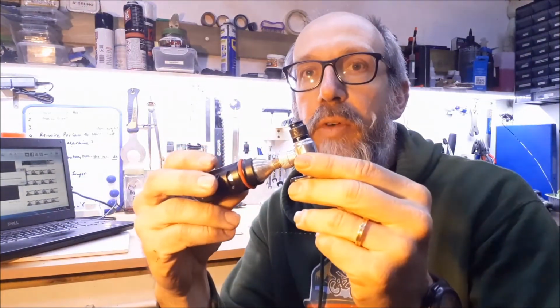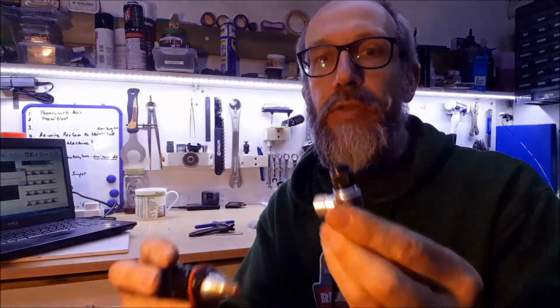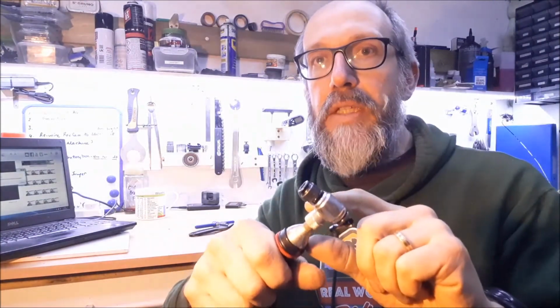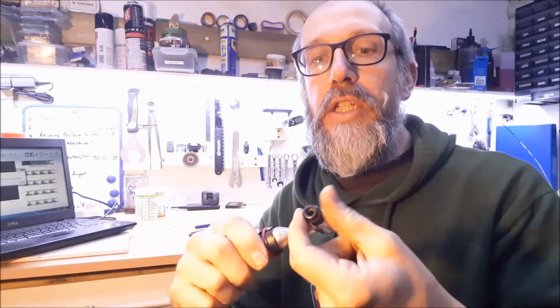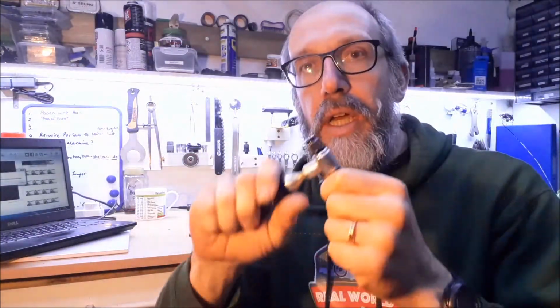So we'll do the quick one first. First up, we've got the CO2 canister. You can buy these in sets or individually. This particular one has a plastic cover on it, and that's going to be quite useful. Then you've got the valve, and this one is actuated by screwing it in and then screwing it right up tight, and it pierces the valve. I've then got a lever to release the CO2 into my tyre. It's a universal valve, so I push it over, it's got rubber on the inside, and you rotate it and push it on, and it finds its way onto your valve. Then when you're good and ready, and this is done up tight, you release the CO2.